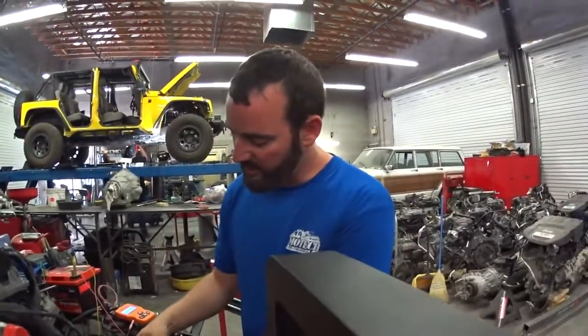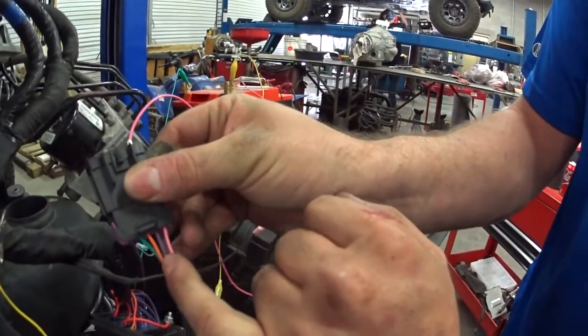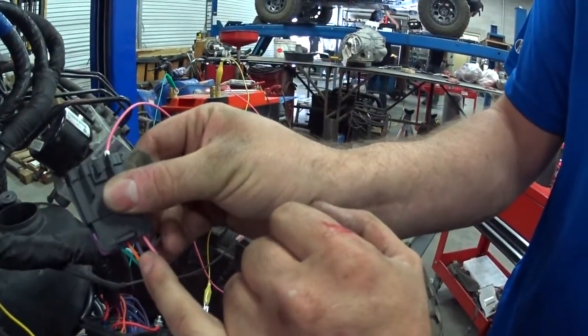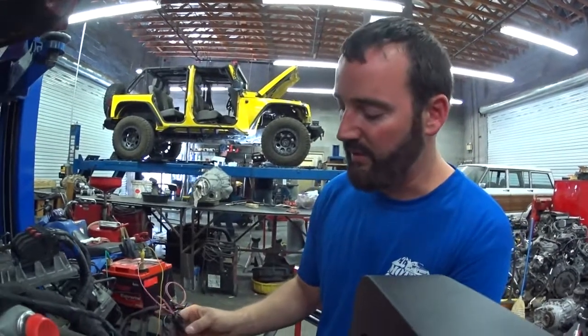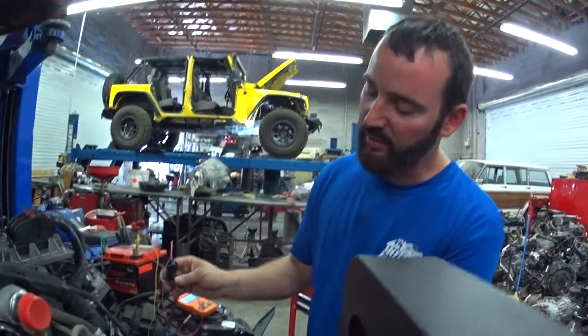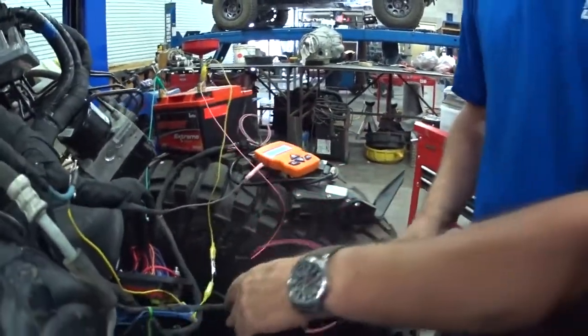On this 5-pin connector, we're only using four wires. We've got ignition, crank and cam signals, and green is AC pressure. These will pretty much be plug and play to your Jeep harness that we modify. This blue wire is for a Pentastar — it runs into your Jeep high pressure side and you tap that in for your AC to work.